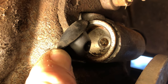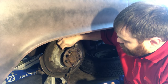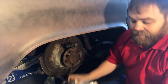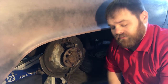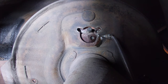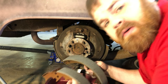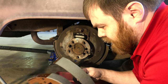That gives a root cause as to why I was having the problems I was having. These wheel cylinders — you can rebuild them for about $3, or for about $10 you can get a brand new genuine AC Delco wheel cylinder. So that's what I did. I've got brand new hardware and I'm going to get it put on. These new shoes I got with the lifetime warranty are not riveted — they're just glued.